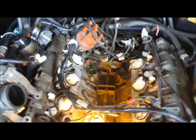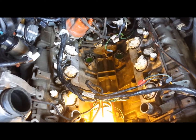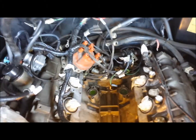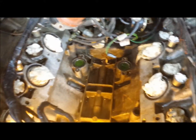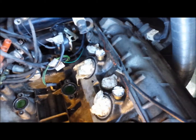Progress so far — I've still got to do a bit of cleaning, but I have taken out all of the injectors and also the spark plugs, and just generally tidied up things in here. The distributor cap is still on, but I've managed to get all the extra bits and pieces out of the way so I can start cleaning. A bit of carb cleaner on there has helped clean things down, and I think getting a toothbrush in there is going to be my next little trick.